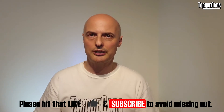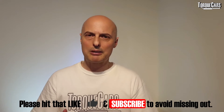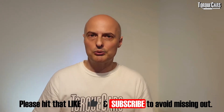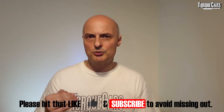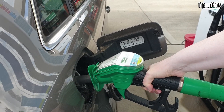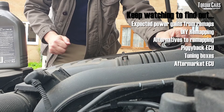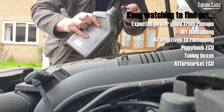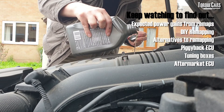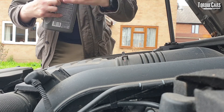Because there's that leeway, we've got scope to play with. By altering the mapping we can reduce that leeway. If you put your car on a rolling road you get live information about what the engine is doing and how the fueling is working, and you can adjust it on the fly. If you're serious about performance you might want a map that only works well on premium, higher-octane fuels — releasing quite a bit of extra power. Essentially you're saying: I'll keep the car in good condition, use good fuel, and service it more regularly — I just want maximum performance.